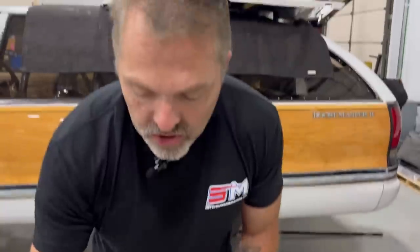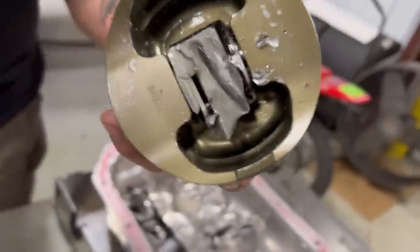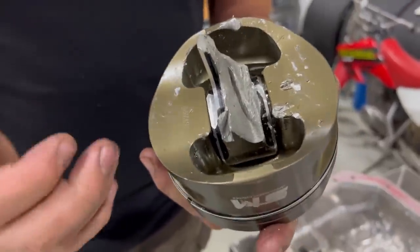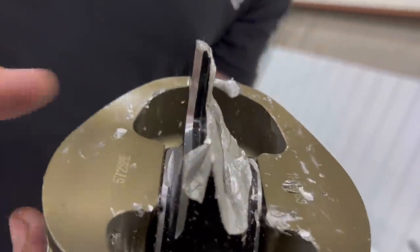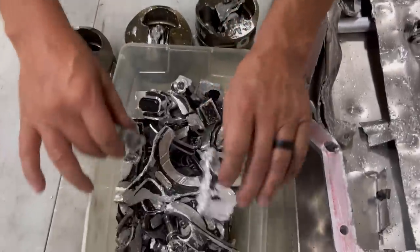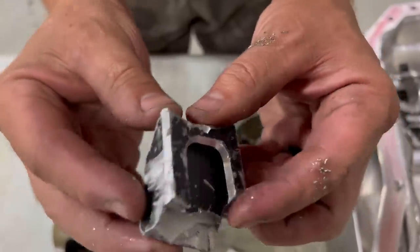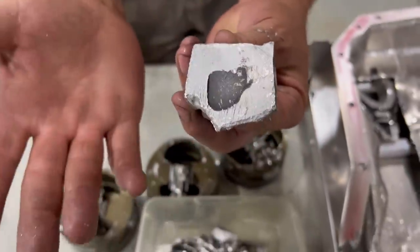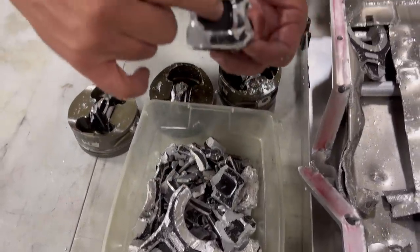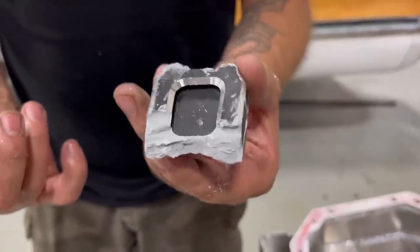So, long story short here, look at the break. This is material. Material, bad batch, way exceeding whatever this material is designed for. Design, maybe a little bit of machine work. There are some pieces here, like here's a piece of the beam. You can see that this whole side of the beam, this is one side, the whole other side is gone. It's just gone. So there's some areas here where it broke right at the tangent of the machine line. Maybe that's a little bit. Maybe it's a little bit of this black anodizing. There's a lot of things here that I'd like to have answers for.